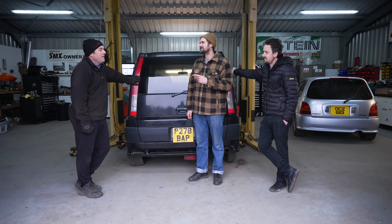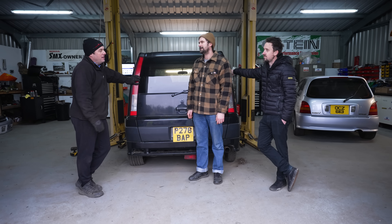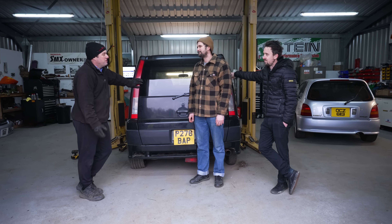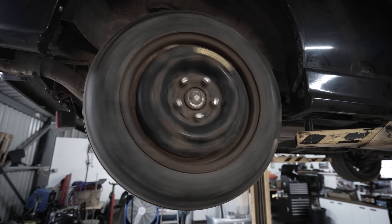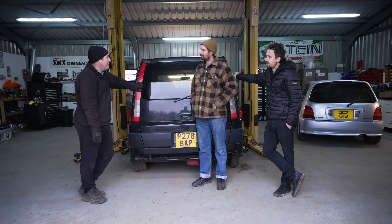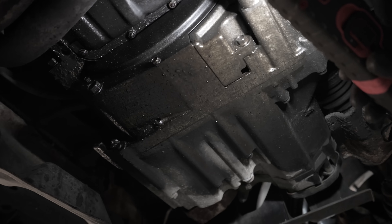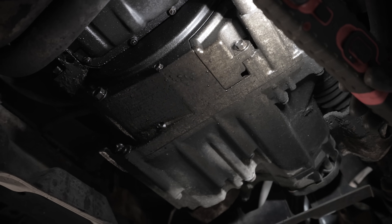We regrouped with Lee to find out the total damage. The mechanical stuff on this isn't too bad - Honda's really good mechanically. It doesn't need a lot. It needs a couple of drop links, which are not a lot of money. Wheel bearings are a little bit difficult, but we've got a breaker coming up so we should have a wheel bearing for it. It needed a bit of exhaust work, just needs fitting better. Oil leak - gaskets, a bit of sealant, that'll sort that out.